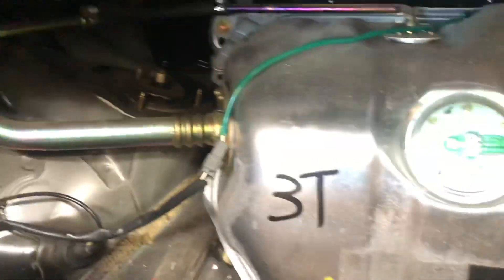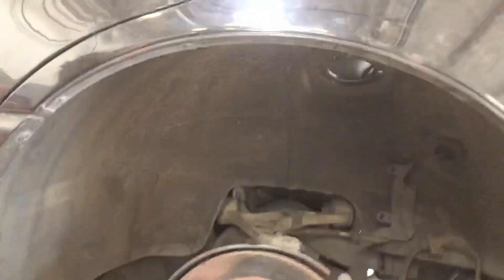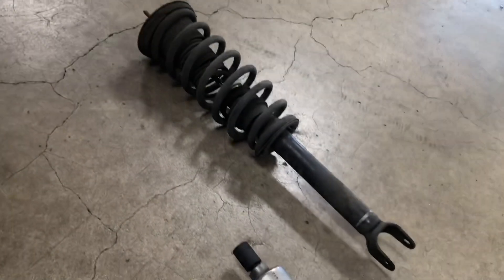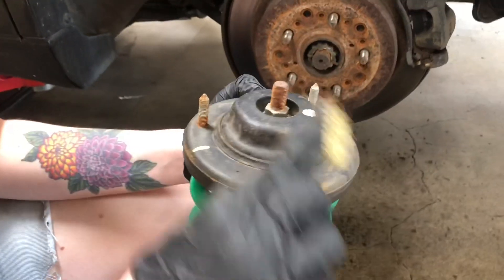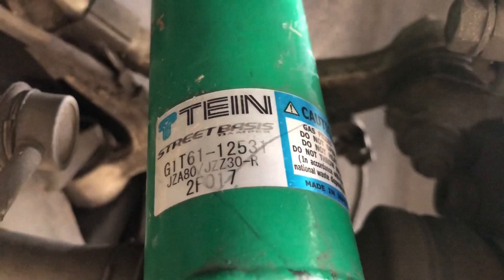You can see the top hat back here. We're just throwing the bolts on top — we don't want to tighten anything yet, we'll do it all at once. Then we'll swap over to the other side, get the old strut out, and put the new one in. Shelby is cleaning off the threads because these have been sitting for a while and have some surface rust. The second strut took a lot of people standing on it and yanking to get out — these things are long.